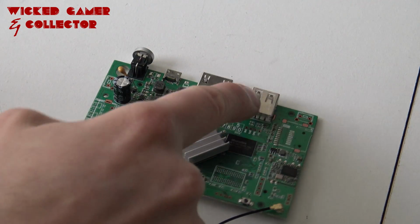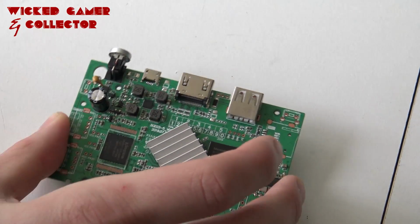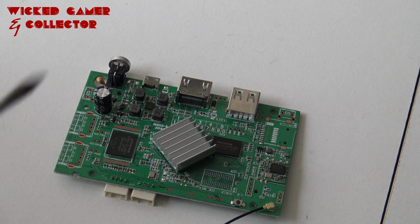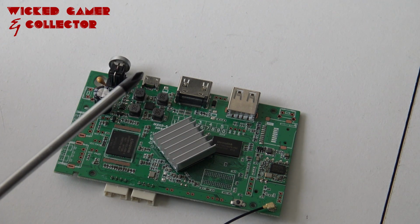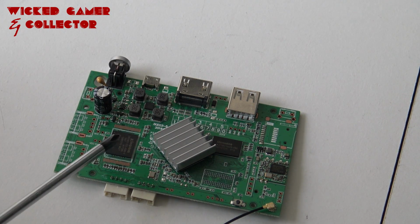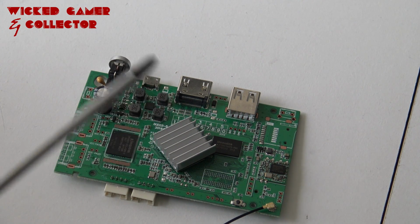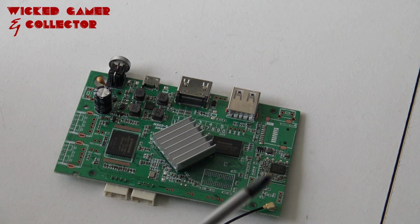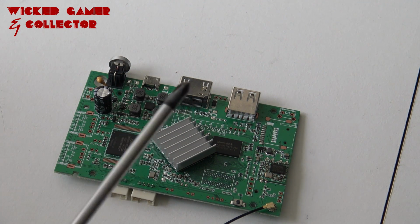Alright, so here we have the USB connection, HDMI, the micro USB for the power, and the little clicky switch that we can find. We're having here a small capacitor. But right, so here at the left we can find this Kingston eMMC. It's an M627, and this means this is a 4 GB storage chip. So if you are going to do an update, I'm hoping Capcom will bring out an update some way, and they want to store the files on here, it's still possible. 4 GB. Let's say that the main file is around 15 up to 20 MBits. Correct me if I'm wrong.